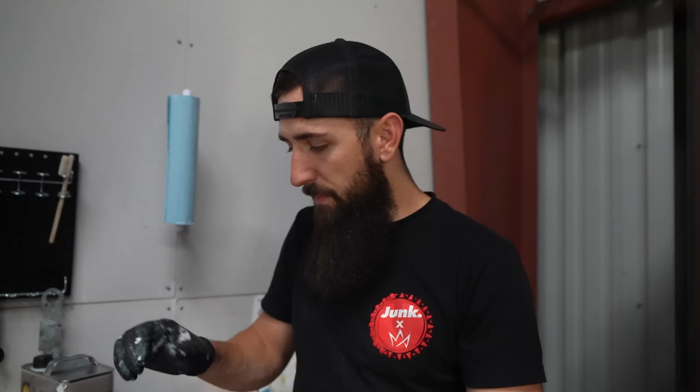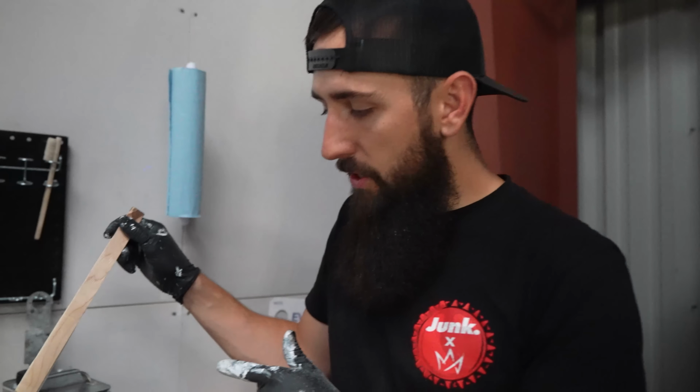You would do a base silver metallic, and then you would do a red mid coat over it, and that candy would build up and the layers would get darker and darker as you went up. Similar to what the paint on the back of my Supra is. You could do candy blues like that, but essentially you start with a metallic base. Kind of what we're doing now is we did a black base, but we are doing a blue mid-coat pearl.